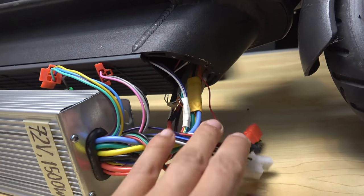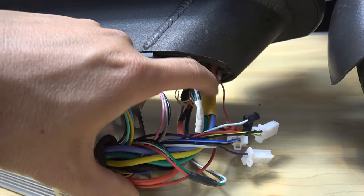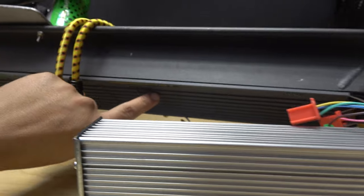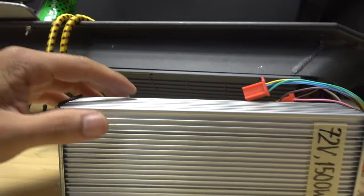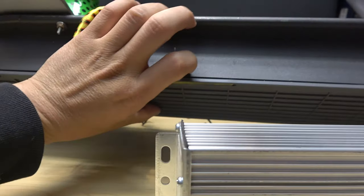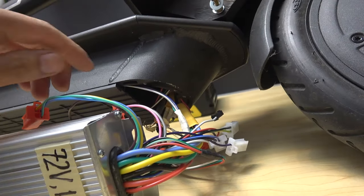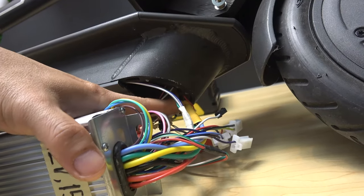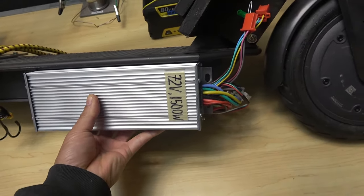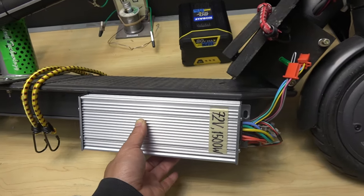I have just finished wiring the controller to my scooter. It's just basic wiring: the power cable to the battery, three-phase power cable to the motor, hall sensor, and throttle control. I was planning to put this controller inside the space where the battery used to be, but the problem is this controller is way too big — its width is larger than the battery space inside the scooter. So I cut the bottom plastic cover and made a hole to feed the wire through, then I'll mount the controller there and use a bungee cord to secure it, just for this test.